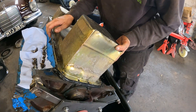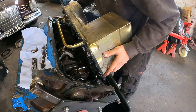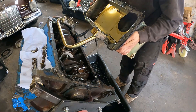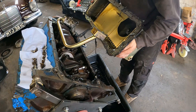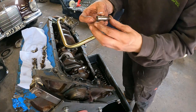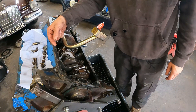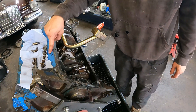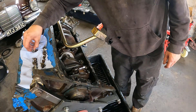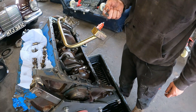And off it comes — it is well stuck on there. No sign of our lifter just yet. Here's what's left of it and that should have another bit on the bottom somewhere in here. I lined all the bolts up because sometimes in a sump they're different lengths for different thicknesses and if you put the wrong one in it's going to bottom out or not be long enough. But it looks like these are pretty much all the same — it's had a couple of replacements put in which are slightly different but almost the same. I'll stab them in a box and make sure they all go back in the same place. Bit of sludge and old gasket in the strainer — not too bad. Let's carry on investigating.